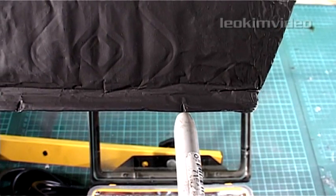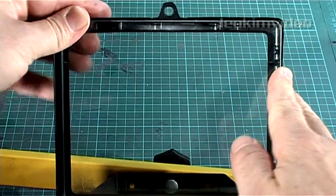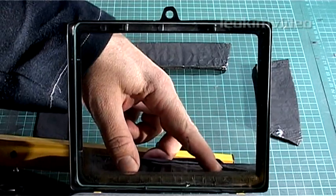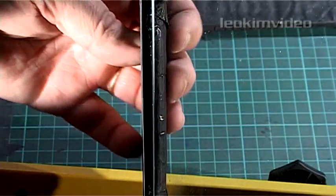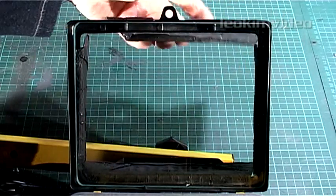You can see the impression made on this door by the lugs. The trick to installing all the doors is to settle the glass in, riding the glass retaining lug. It's now a matter of working the doors into the space between the glass and the retainer, making sure the folded edge goes completely home. This can be tricky, so be patient and thorough here.